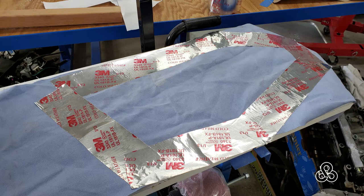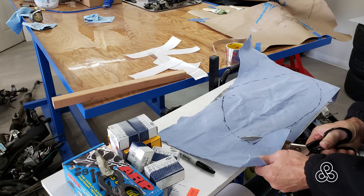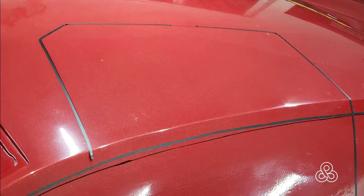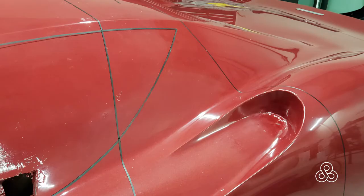A lot of parts in the car are symmetrical, like the headlight lenses, so I'm making a template here out of just some canvas and tape. Make that template up, put it on one side, trace it out, flip it over, mirror image on the opposite side, and you have your templates. Same thing for some of these other openings — the doors and hood opening in the back. The parting lines are ready.